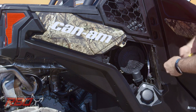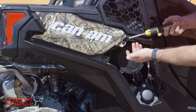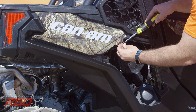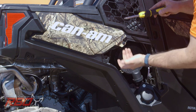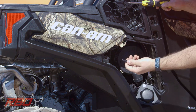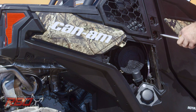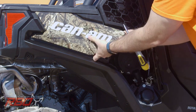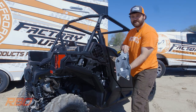Put that off to the side. This panel has a panel lock — a little plastic piece — and you're going to use a flathead screwdriver and gently pry on it until it unlocks itself. Then the rest of it pulls right out just like that. Save this and set it to the side. The rest of this panel has locks on it and you just gently lift it up and it pops right off.